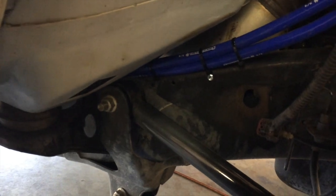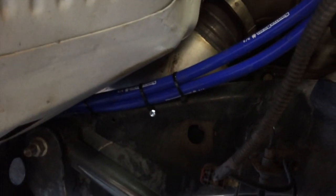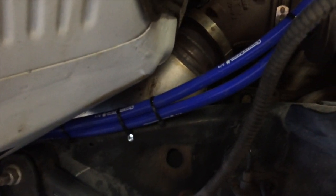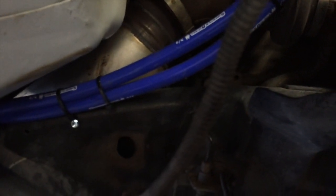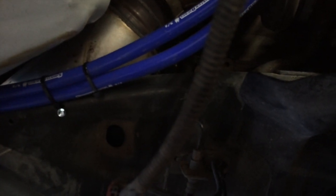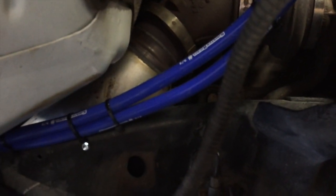It's a really tight spot. You've got to watch your upper control arm - there's a pivot right there and you're running right across the top of it and up against the frame rail. One of the problems with this kit is I really don't like it down on the frame rail - it's right behind your front tire. If anything were to happen, you're going to knock the filter off. Though you do have the shutoffs to cut it completely out of the circuit. Another problem is they only give you one zip tie with this kit - I used several. You've got to keep it away from the exhaust and turbo, and there are a lot of areas where you can chafe against. If you cut a hose and you're out on the road somewhere, you're pretty much screwed.